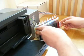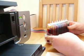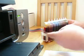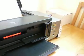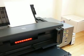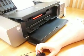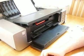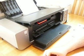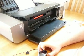Once this is installed, you can move the roller into the up position. This will allow the ink to flow, so this should always be in the up position — you don't need to close it when you've finished printing or at night. You can then line the continuous ink system up at the side of your printer. Before I do any prints, I'm going to do two deep head cleans and a print head alignment to flush the old ink out and bring the new stuff in. I'm selecting all colours on the monitor and this is going to take a couple of minutes to run.